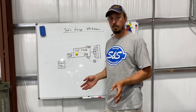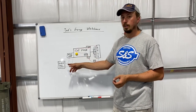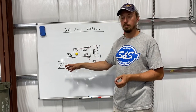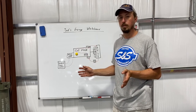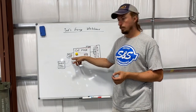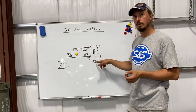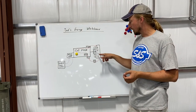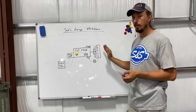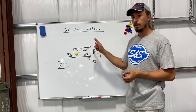Here's the change I made that addresses all of these concerns. I added some external transmission coolers that I'll show you in a minute. I mounted those underneath the RV, in front of the rear axle. I ran hoses from the transmission to those coolers and then basically plugged off the factory transmission cooler. So I've got essentially the same cooling capacity as before as far as the coolant is concerned, but now all of that is dedicated to the oil and the engine.